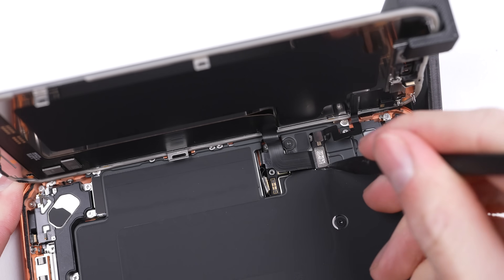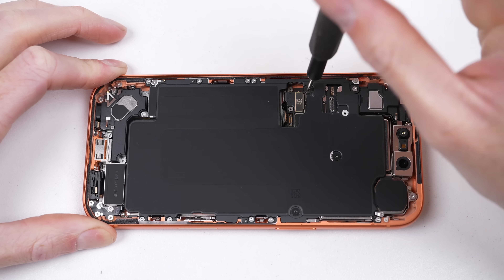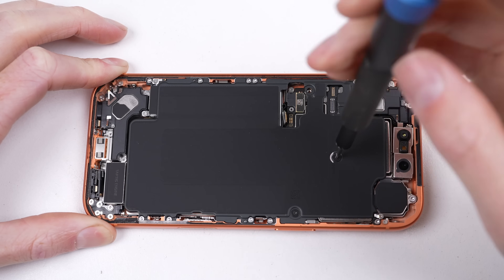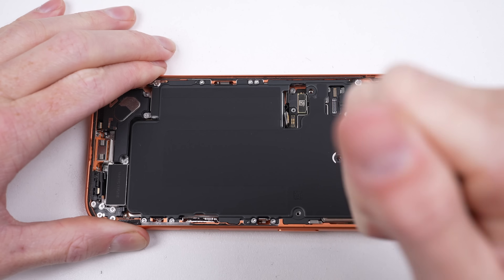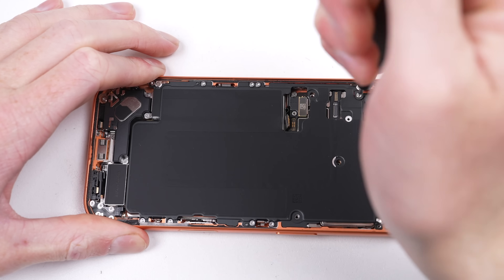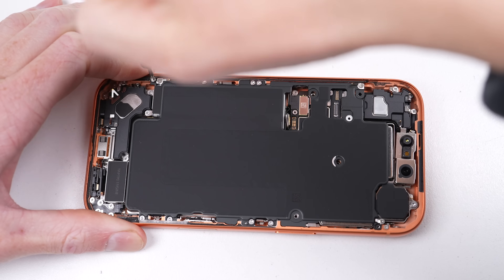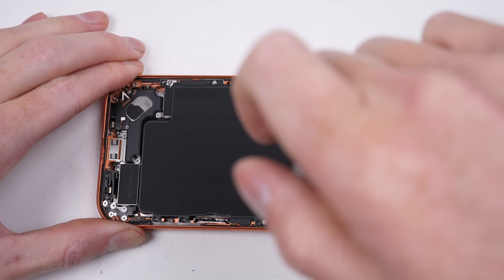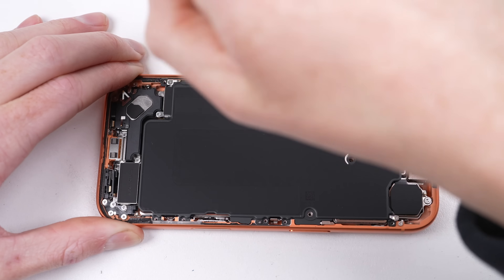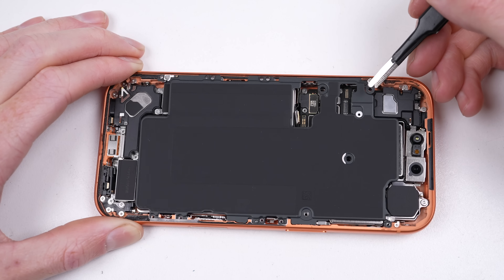I'll get the battery unplugged before detaching the display's two flex cables, the smaller of which looks to be very fragile. Next we can remove all those Torx screws to free the vapor chamber. Articles online suggest the return to aluminium from titanium was so that the heat from the vapor chamber could be better dissipated through the frame, but we'll have to judge that for ourselves. All these Torx screws had been secured very firmly — likely this plate also gives structural rigidity to the phone.